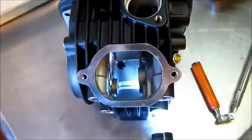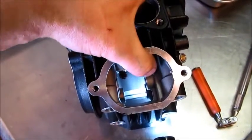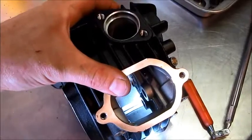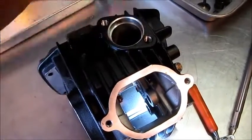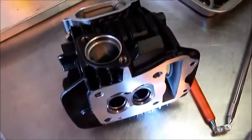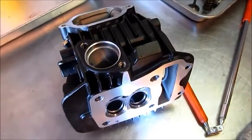When you first start up a bike like this and it's got that much powder coating stuck to the valve, I think it could easily cause a problem — with some powder coating or plastic getting stuck in between the face and the seat and not sealing up. That's just kind of a bummer. Hopefully these guys — I'm going to send this video to them — can correct the issues.